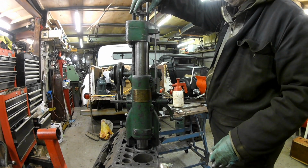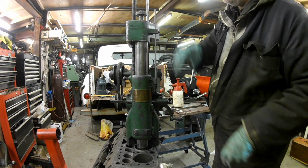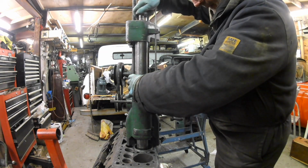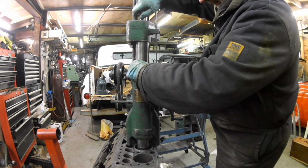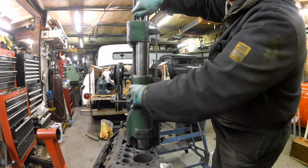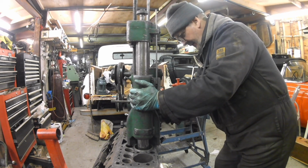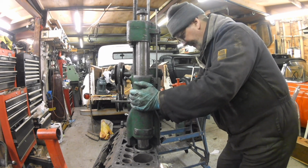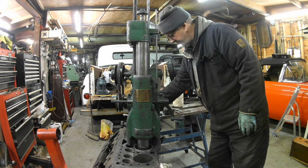Right, you turn this knob here, this dial, and it winds out the cat's paw legs. You wind those out, and you can see it's actually moving the machine. It's pushing the machine square. Is that? No, it's still loose. So you kind of wobble it about. Then they go solid there. They're in the bore now, solid in the bore, and you can rock the machine around the boring bar. Okay, and I need to put my clamps back in.